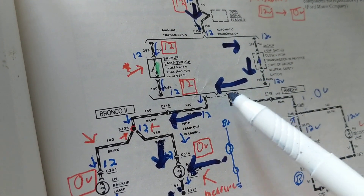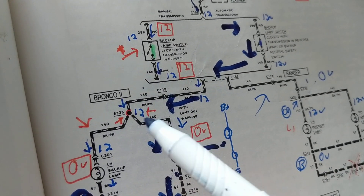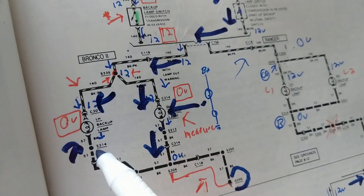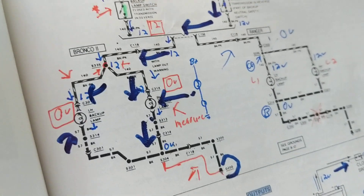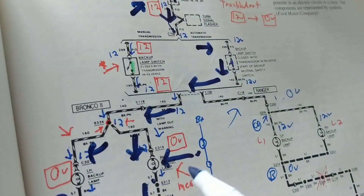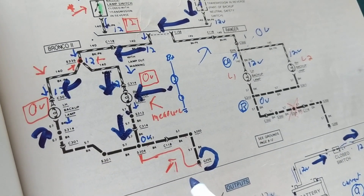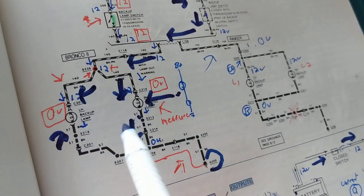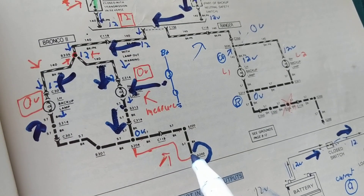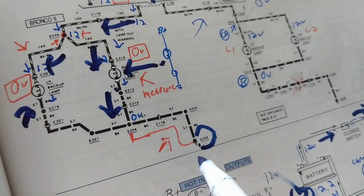At the splice — 'S' is a splice — we have two paths: one this way and the other that way. We take the path that connects to our component. Are we done? No — we still need a ground. Let's say both lights are out and I think the fuse is the problem — I start from the fuse. Or let's say I think it's a ground problem — corrosion or high resistance, which is always the case. If it were only one light out, it can't be a ground problem, because the ground is common to both. If the ground is bad, both lights will be knocked out. So it makes sense to go look for the ground.